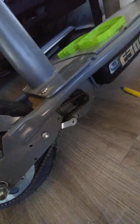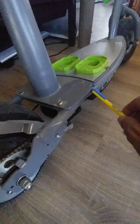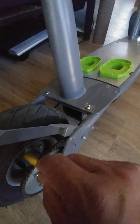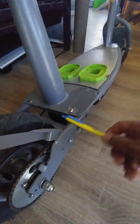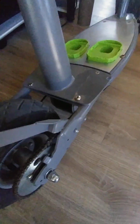36 volts running on the existing DC motor here. It's underneath. It's part of these scooters. That's a 24 volt motor. It is stressing this motor, but since my goal was to remove this and put a direct drive here with a brushless motor directly on the wheel itself, and change the speed controller to a 36 volt brushless type controller, I'm not too worried about burning out one of these motors at some point. Plus, I have so many other scooters that use 24 volt motors, so I could swap it. Not a big problem.